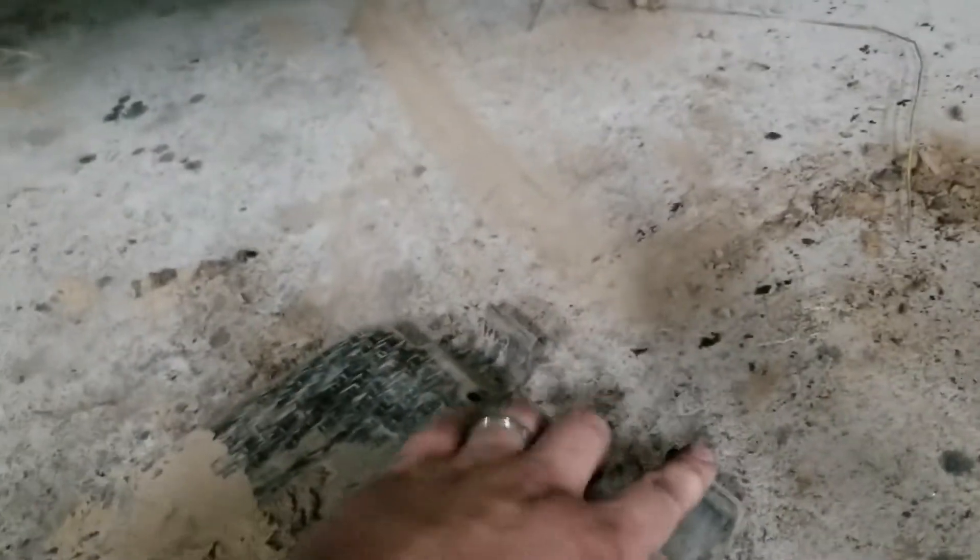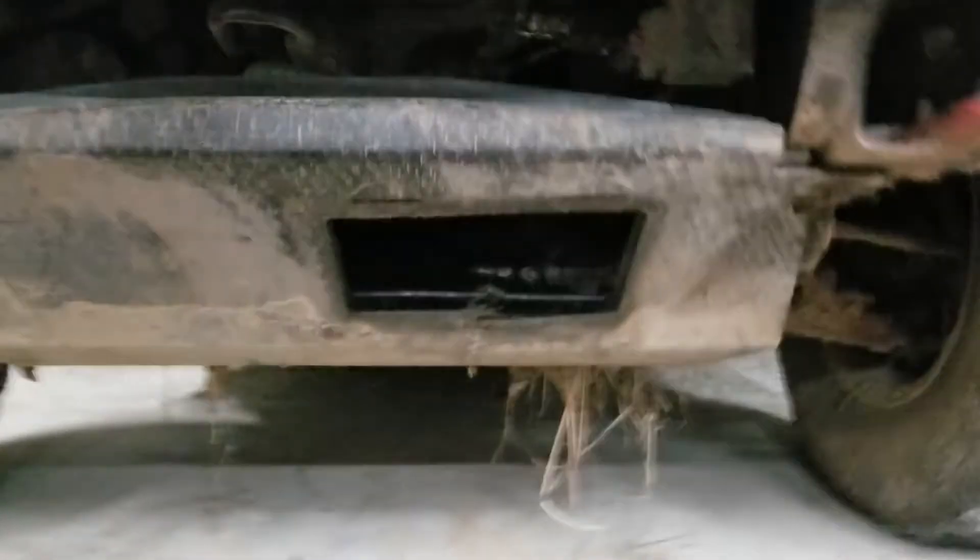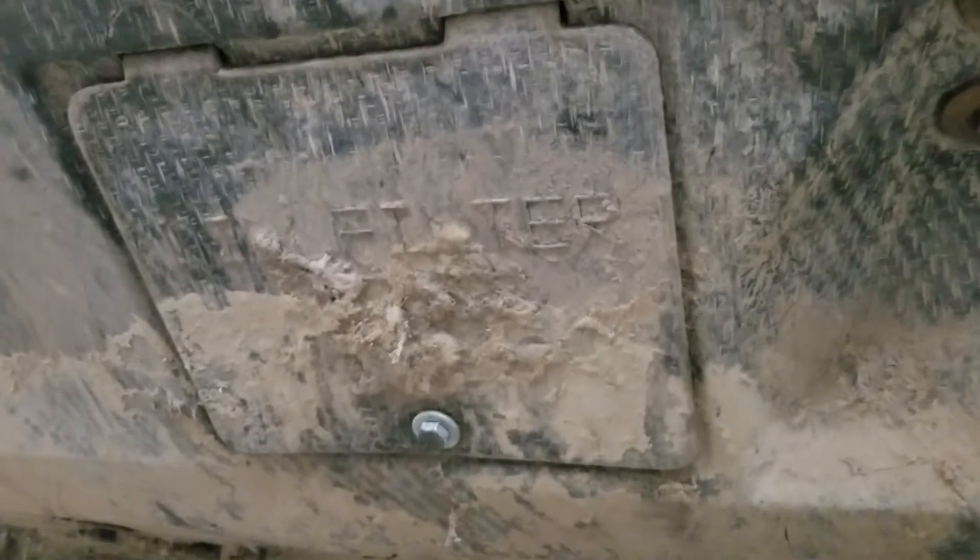I put a 5/16th J-nut in here rather than that stupid quarter-turn deal — gotta help get some strength back to this. This part sort of hits on the other skid plate in here, I cut the excess. You can kind of see both of them there. When you stick it in, it tightens everything up real nice, so I'm sure it actually makes it stronger. Oh hell yeah — way more solid than it was. That's gonna work mint.